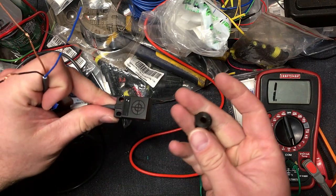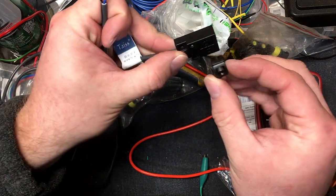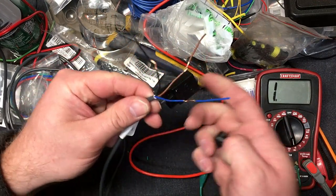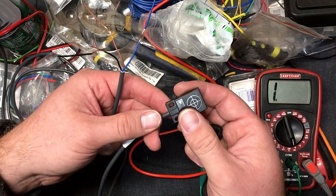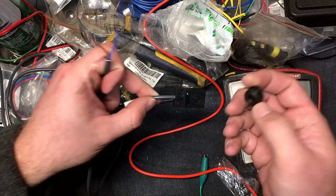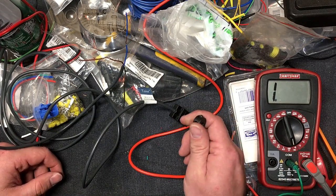The way this is going to work is I've got this little shaft collar that's going to go on the shift linkage there. And then this little guy is going to hang out — this is a prox, an inductive pickup sensor. It's an NPN transistor that picks up this little guy through magic, I assume. It'll pick this guy up only when it's in the neutral position. I've done this before — this is how I set it up in my Honda, very similar type of setup. I think this one's going to work a little better.